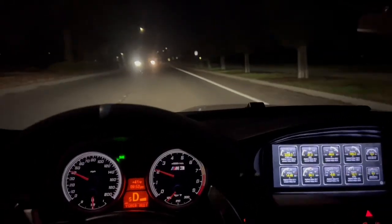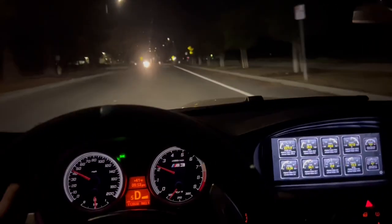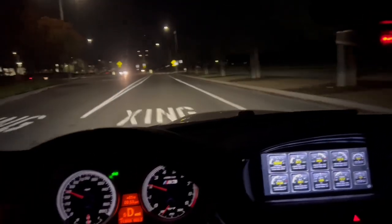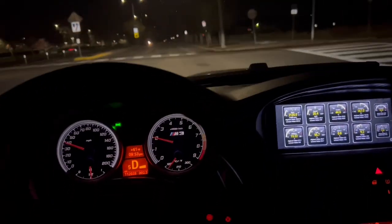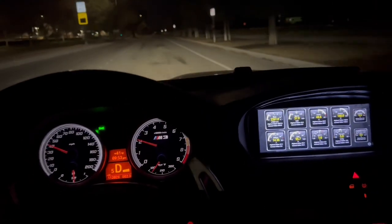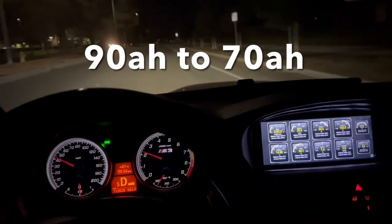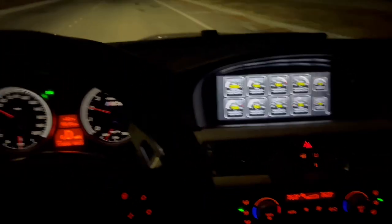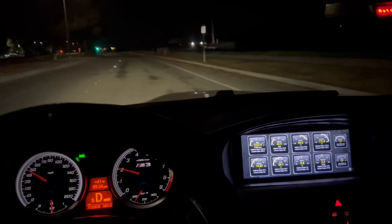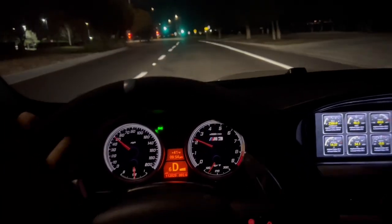It's as easy as that — the battery is coded. I have a lighter battery in, better performance, and saved about 25 pounds for around $200. I'll update you guys if the lower amp hour — 70 down from 90 — affects the car at all. So far I drive normally, everything is smooth, and the alternator is working and charging at 14.4 to 14.5 volts. Thank you guys for watching and I'll see you on the next video.